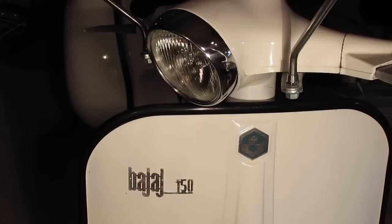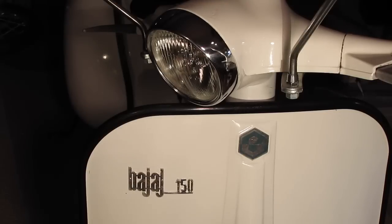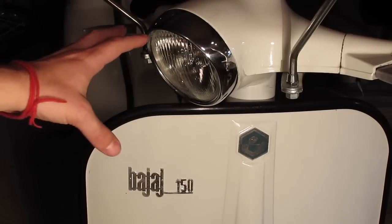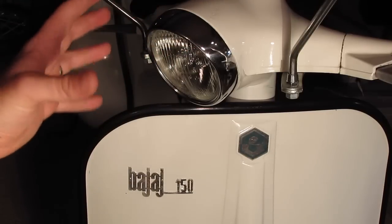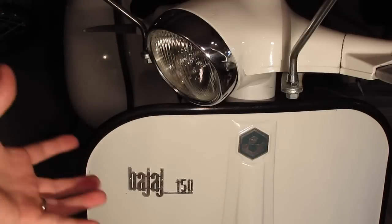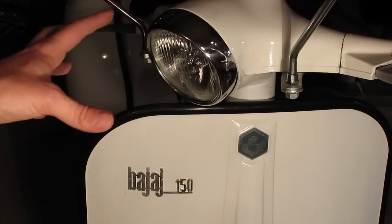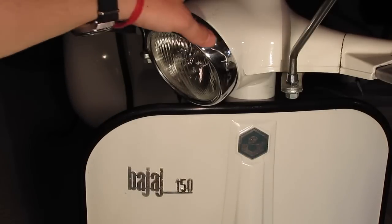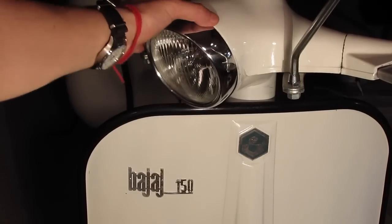I made an attempt to replace the brake lights with an LED. It's my first foray into this, and I quickly discovered that because this is an older bike, it doesn't have a battery. It has a generator, and the generator is AC. It's not even DC. So it's got the generator, which produces enough electricity to spark the spark plug, run the headlights and tail lights, but not turn signals. It doesn't even have turn signals,